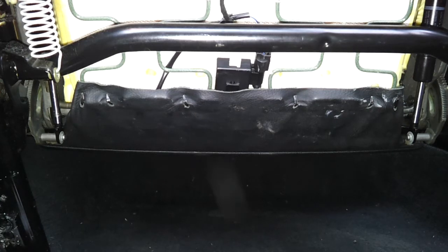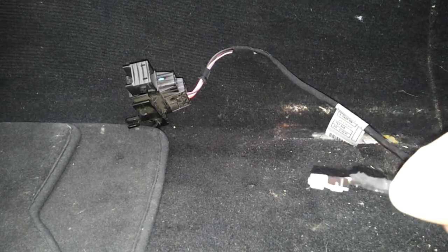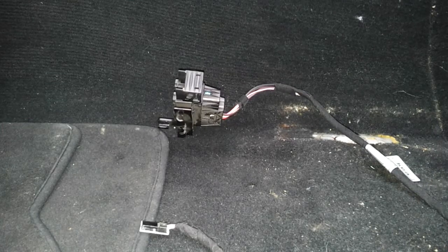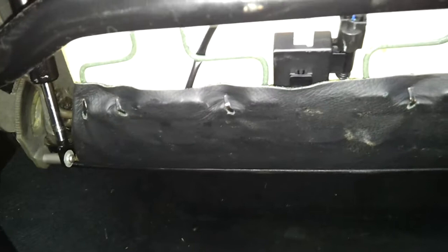That was a straight swap — I was able to just remove the harness. What I did was I took the black plug wiring harness off the newer seat, and the plug for the passenger seat occupancy sensor was the very same. So I just took that off and took the wiring harness from the old cloth seat and plugged it straight in with the yellow plug into the black box, with the little white connector on top of it.